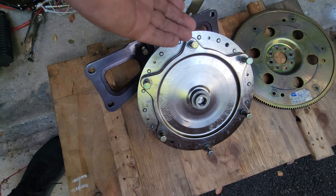Okay, a little update on the 13 GT. You guys know this car — bought it to give the common man some kind of representation on the channel. P-mass, E85, LE47, 18 manifold — easy stuff. We've been on a catch can kick on this car, talking a lot about catch can setups and ventilating the crankcase, especially on boosted setups, because the amount of ring land failures I've seen on very low boost applications is mind-blowing to me.